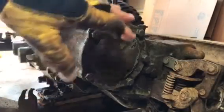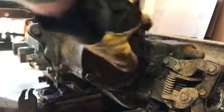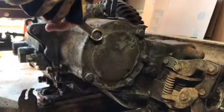I'm going to take advantage of the fact that the transfer case and transmission is well supported in the frame right now, and I'm going to remove these five bolts. If you notice they're F-marked, they're Ford scripted, so I can remove this cover. The PTO access cover is part number A1508.